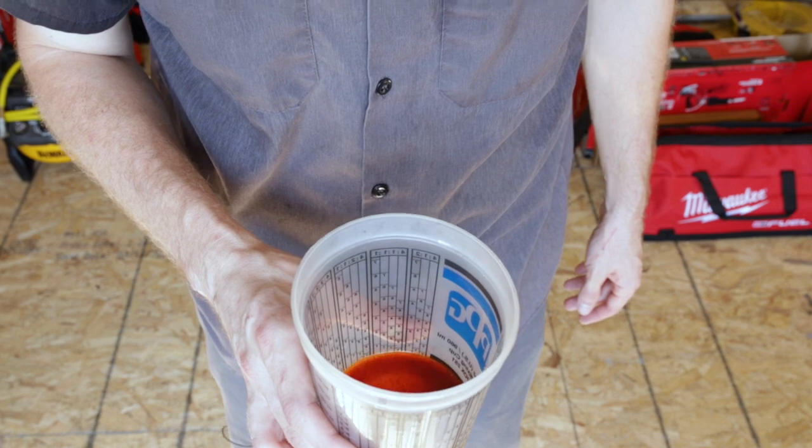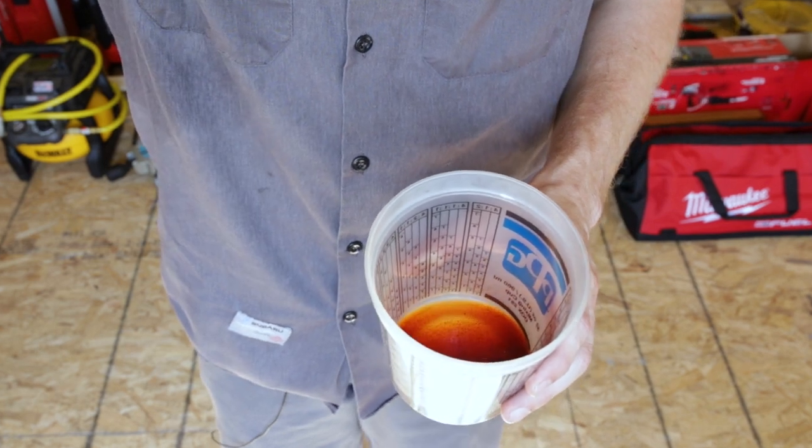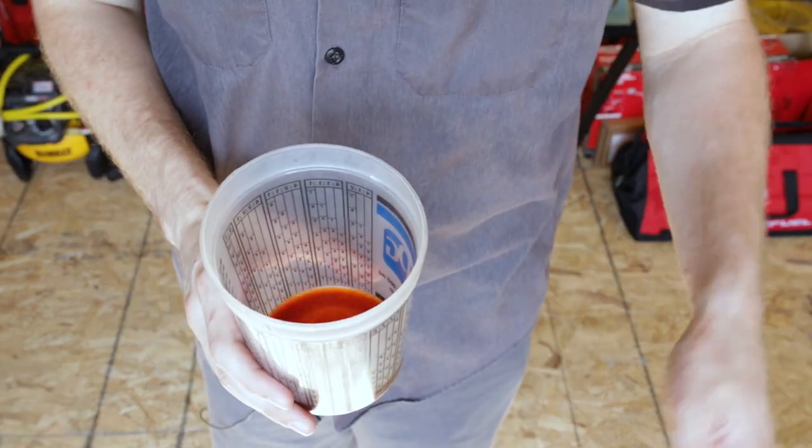That's just a stop leak. That's all it is. There's no modifier for the cooling system or cooling capacity. It doesn't help disperse heat out of the cooling system any better. So yeah, that pretty much confirms it: Holtz Rad Weld and Subaru cooling system conditioner are the exact same product — just a half-size bottle with a different sticker on it. Confirmed: same smell, same look, same consistency. It is what it is. With that said, I think we'll wrap up this video here. Thank you so much for watching. Hope you learned something. Hope you enjoyed, and I will see you in the next video.